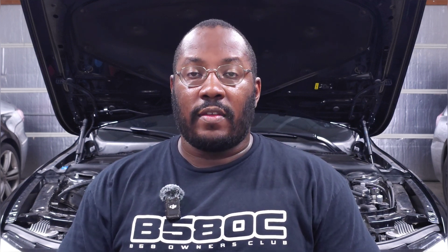Let's go over what a boost leak is. If you have a turbo on your engine, it's creating positive pressure and pressurized air goes into your engine. You want all of that air to make it into your engine so your car can run as efficiently as possible. But sometimes cracked plastic parts, loose silicone hoses, and other issues can cause a boost leak. When the car pressurizes the air, a little bit leaks past those joints, causing you to lose power, mess up your fueling, and in a worst case cause misfires.